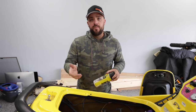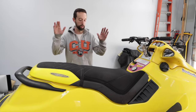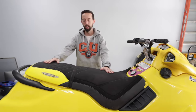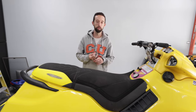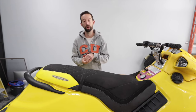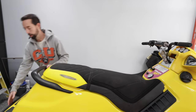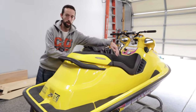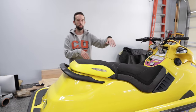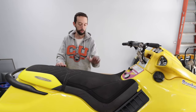The only last step is to pull your battery and put it on a trickle charger. Also, get yourself a good cover — depending on whether you're storing indoors or outdoors, make sure you get the proper cover. I also like to use dryer sheets or rags soaked in peppermint oil placed under the cover on the inside. A lot of critters hate the smell of peppermint and won't go anywhere near your stuff. Put some towels with peppermint oil in the exhaust, maybe under the seat, and on each side of the footwells just in case you have an issue with critters — they love the turf, especially this crusty turf. That's a good pro tip.